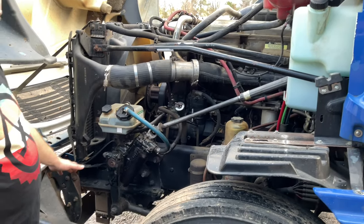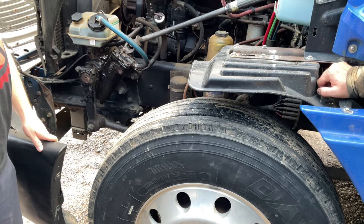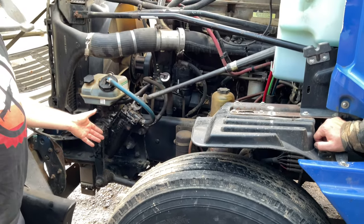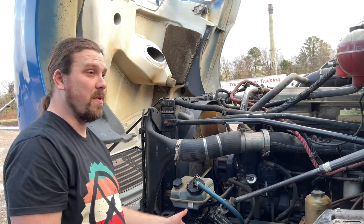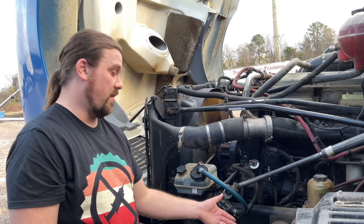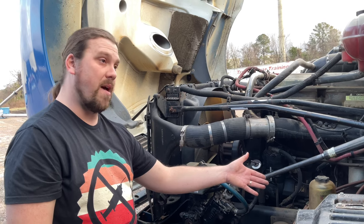On my suspension, my spring mounts are securely mounted. There's no broken, loose, or missing parts. That's both mounts, front and back. My springs, they're not broken, missing, or misaligned. If a quarter or more were missing, it'd put my vehicle out of commission. My U-bolts are securely tightened. They're not broken or missing. My shock absorber is securely mounted and not leaking.